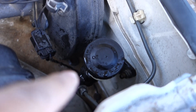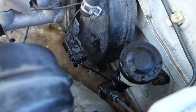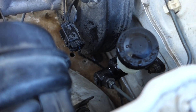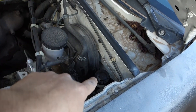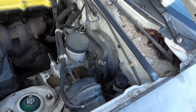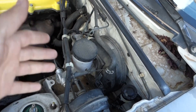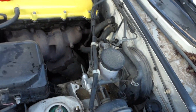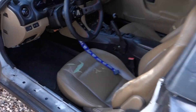I think the issue was this bad boy right here - the clutch reservoir. My dad thinks it had an internal leak, so the air pressure wasn't cycling through properly, and that's why the clutch would give out. That just saved me a lot of money over taking it to a shop, because most likely a shop would drop the transmission first instead of doing small things like this. I'm grateful I actually took baby steps.